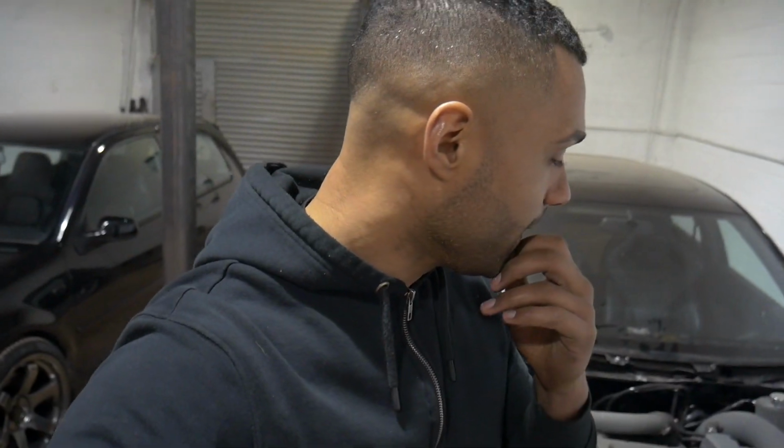I realised I did a few wires wrong and I put them back, and then it started and then it died. And then what I found out is the fuel pump wasn't staying on while the car was cranking or when it had started. When I open a door, the car does prime, and it will do that without having an ECU in it anyway. So that was irrelevant. There was something going on with the ECU talking to the engine or the car or whatever. When I was cranking it, the fuel pump wasn't coming on. And then when I earthed one of the wires, the fuel pump was working. So basically the ECU wasn't sending a signal to the fuel pump, or the relay, sorry, to turn on when needed.